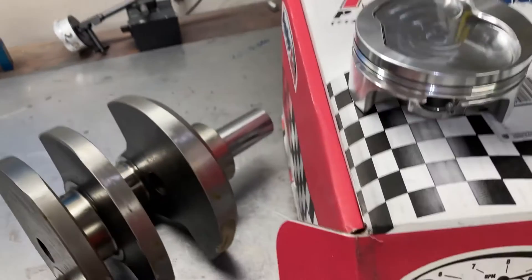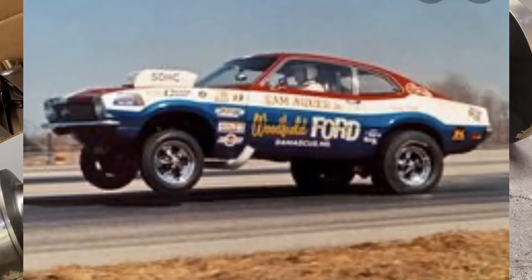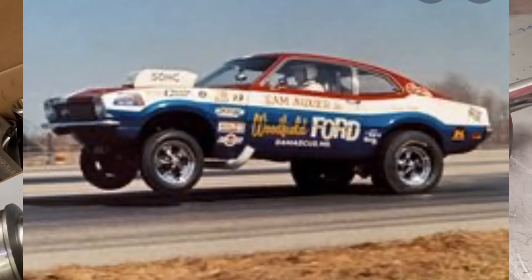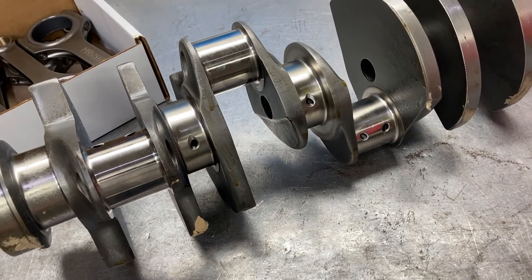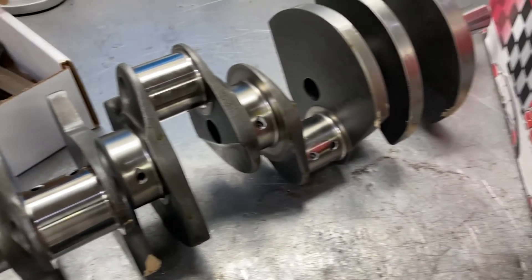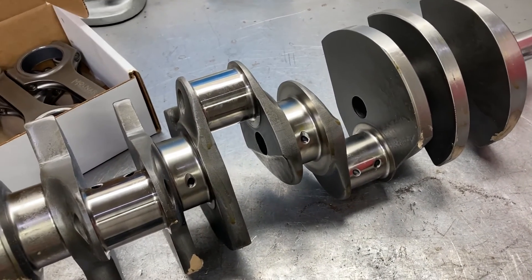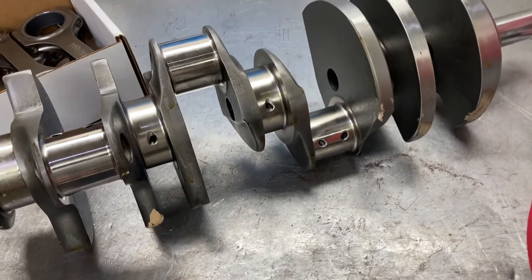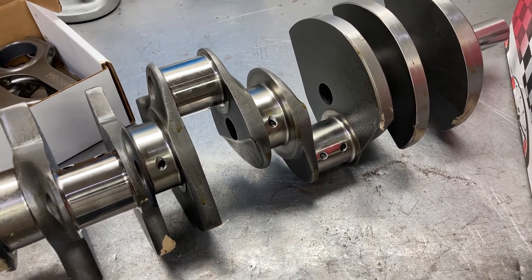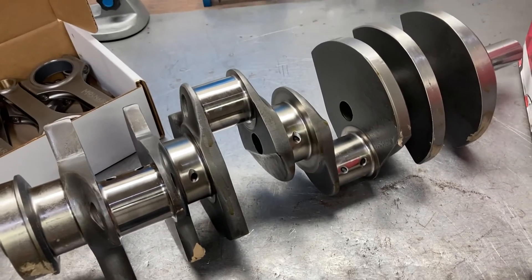The owner of this vehicle — it's a Maverick — used to be pretty popular on the drag racing line, and he's going to make it into a pro street car. So we're doing a street strip build. It currently has a Cleveland in the car, so we're going to continue with Cleveland heads. I always reach out to CHI for Cleveland stuff. For this build we're going to be using a set of their 3V 225cc heads. They will not stay 225cc for very long — usually with the porting we do, it ends up around 260-265cc, and these heads will flow between 380 and 390 CFM by the time we're done.